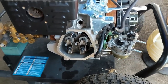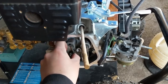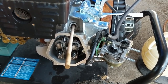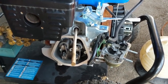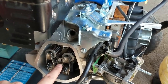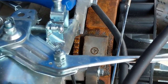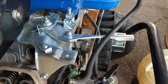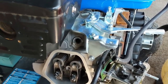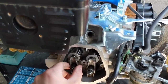I'm using a wooden dowel inserted into the cylinder to find top dead center. At TDC on the compression stroke I can see the magnet on the flywheel is just past the last coil terminal, which means this engine fires just before the piston reaches top dead center - approximately seven degrees before TDC - which is normal. Timing looks correct.